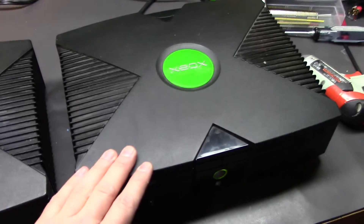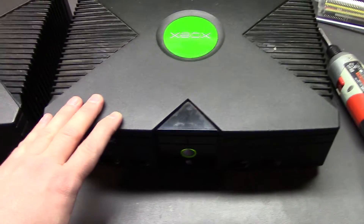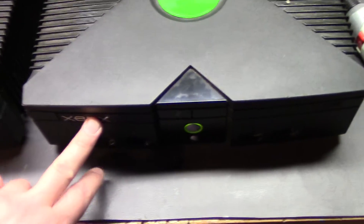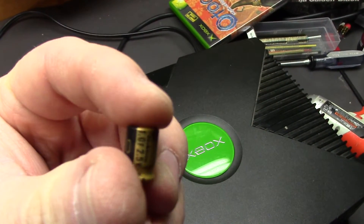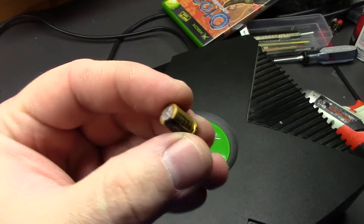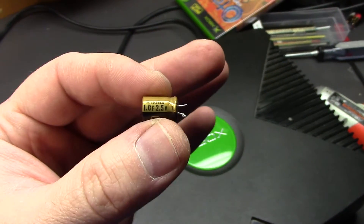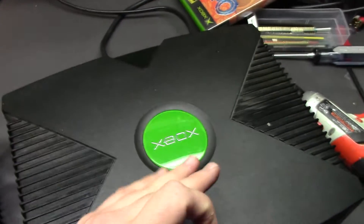But there are some hardware problems on the original Xbox. The two biggest ones are problems with the disc tray not opening or closing because the belt wears out — that's very irritating to deal with. The other is this little guy: this little 1 Farad super capacitor. This one's fine, but over time a lot of these will begin to open up and leak because of the aerogel they use, and that stuff is incredibly corrosive inside — much more than a regular cap.